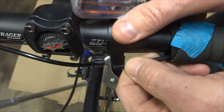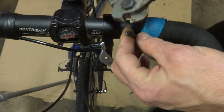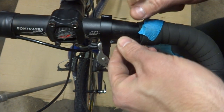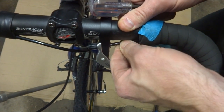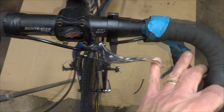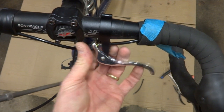I'll test fit this into the brake lever to see how it fits. It's a little bit long so I'm going to trim off a little bit, then use my awl again to open up the lining. I'll try to test fit it into the lever again — and that actually looks pretty good right like that. Now I want to push the cable back through the housing, just kind of push it out. There it is, then feed it through the little barrel adjuster in the lever like that.